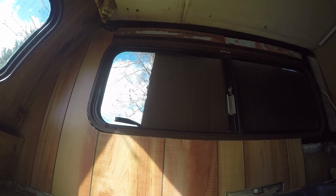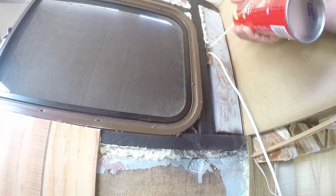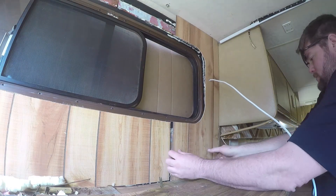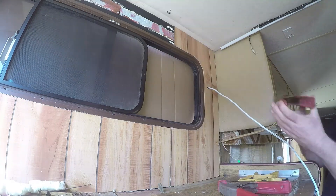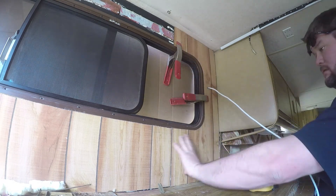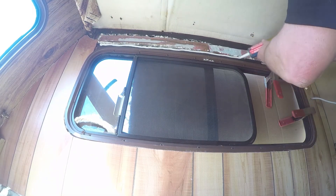Sorry about the light from the windows making everything dark, but we added our liquid nail and replaced our foam block insulation. Now we're going to add our Great Stuff expansive foam to fill in all those gaps all around the window and all that good stuff. Then the next day, after removing all the foam, we're going with the liquid nail and putting up our piece — that's going to fit right into place. I drilled a hole for the cable coming in for the weeboost, and on this side of the window I can actually open the window and use clamps, which I love — that's a lot easier than trying to prop it up.